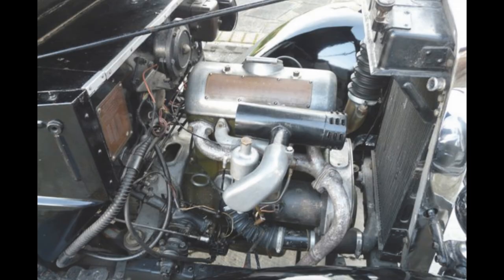To gain access to the carburetor inlet, it was necessary to disconnect the flexible crankcase breather tube. We set the choke, and Rosalind sat in the driver's seat. She pressed the starter and jiggled the hand throttle while I squirted the ether. Success! The engine sprung into life. However, we were not prepared for a surprise. Clouds of oily smoke issued from the breather tube. The bores were very worn, and the piston rings could not prevent hot gases passing them. I quickly reconnected the tube, and the fumes were consumed in the engine.